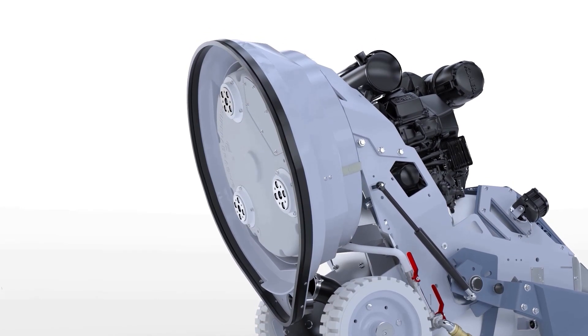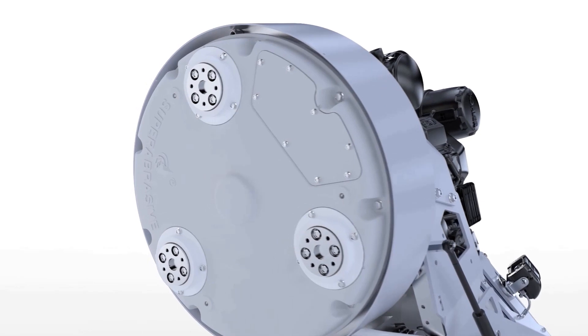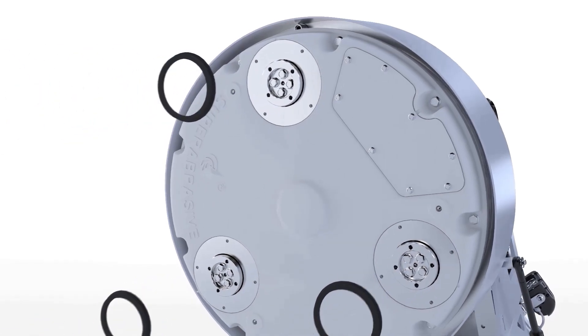There is one on each side. Slide the cover out and set it aside. Unscrew the eight bolts holding the adapter and plastic cover and remove all the sealing elements.